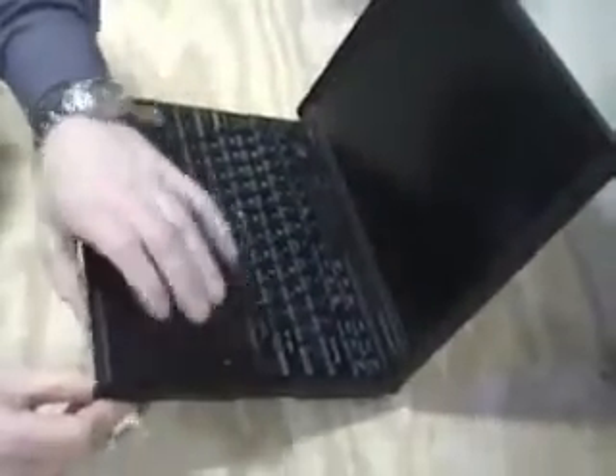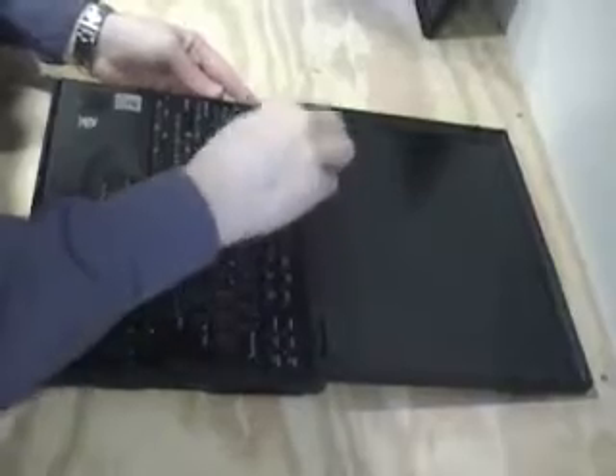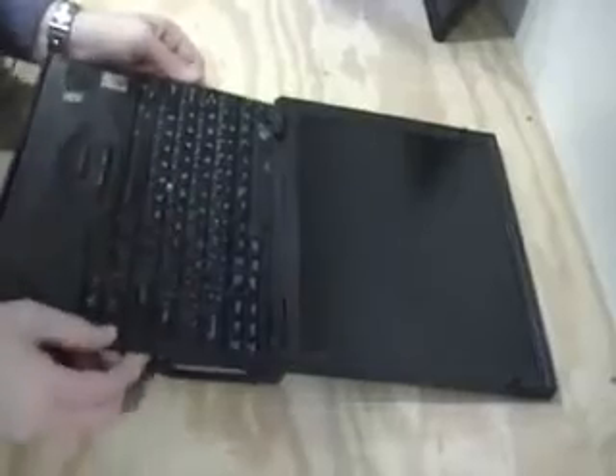Open the laptop back up, like so. Lift a little on the keyboard, gently. Tilt the screen back. I only choose a screwdriver — a little here, a little here, a little over here. Sometimes there are releases here and here that need to be pushed through. In this case I've done this before so it comes off relatively easy. Lay this back, lift it up — don't pull the keyboard too quickly.